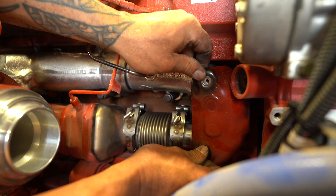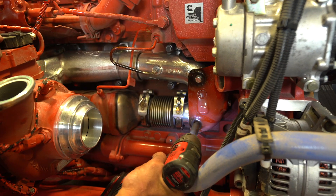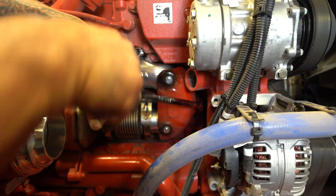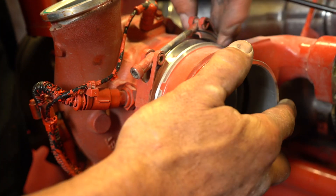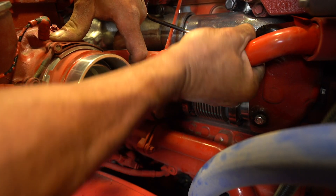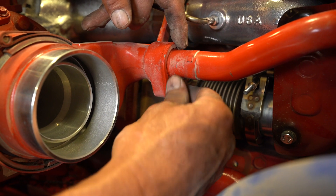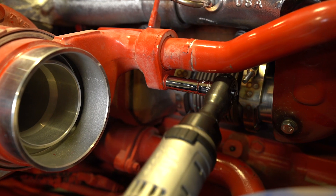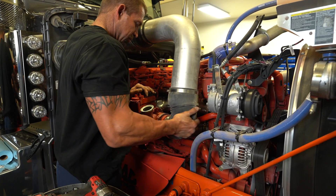As this is a direct replacement, you can easily move the heat shield from the front side of the exhaust manifold over to the new Big Boss exhaust manifold, securely fastened with the three provided bolts. Now we move over to the compressor intake tube, installing it first into the front cover, then set your compressor adapter in place, making sure it is properly aligned for your intake tube, and insert the intake tube and tighten, being sure to align the key on the flange. Reinstall the V-band clamp and tighten. Next, you can move to your intake air piping, reinstalling and tightening the clamps on the rubber boots.